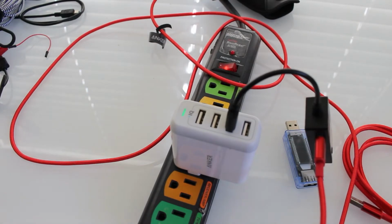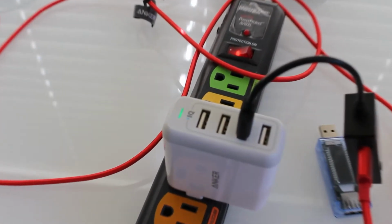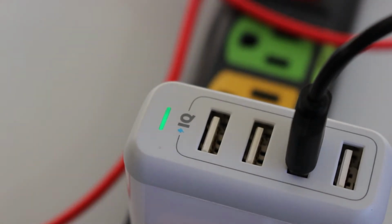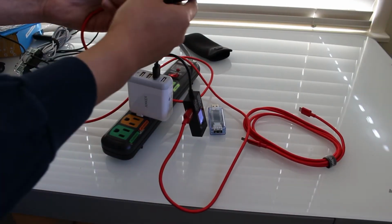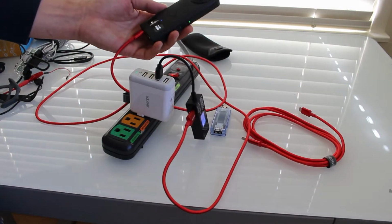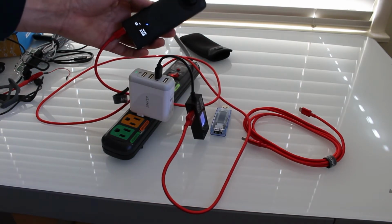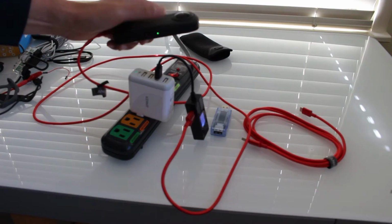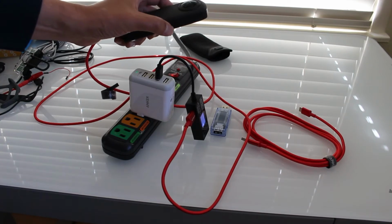The PowerPort LED is a solid green. Even with the camera off, it is charging at 0.68 amps. Test with putting the camera into sleep mode, which is a short press of less than 2 seconds. Waking it up, the LED on the PowerPort4 still appears to be green, regardless of the condition of the camera.